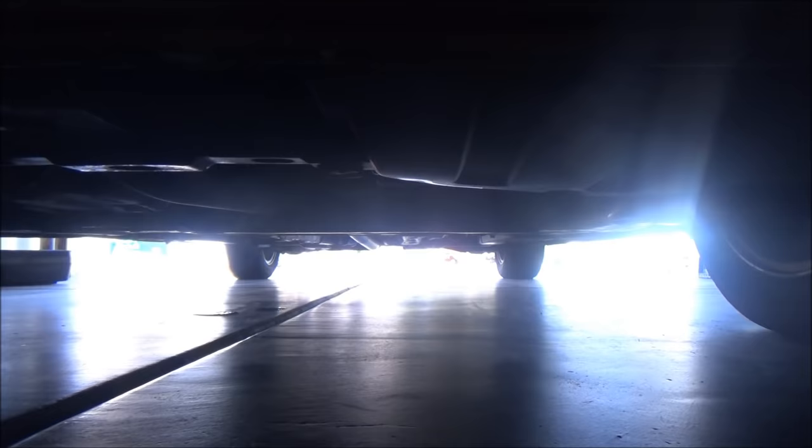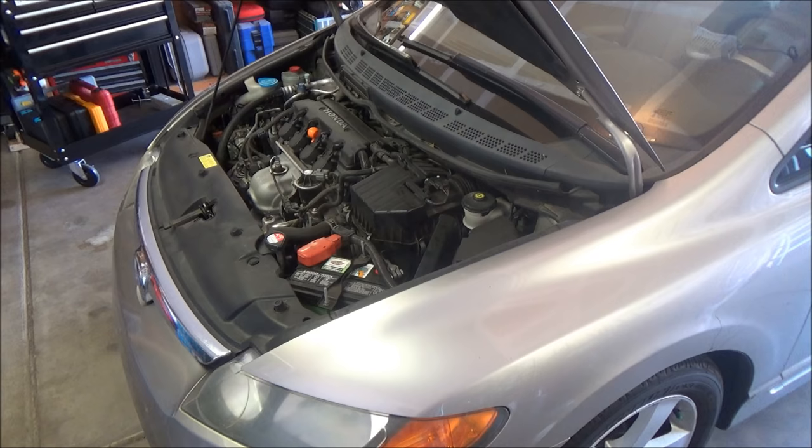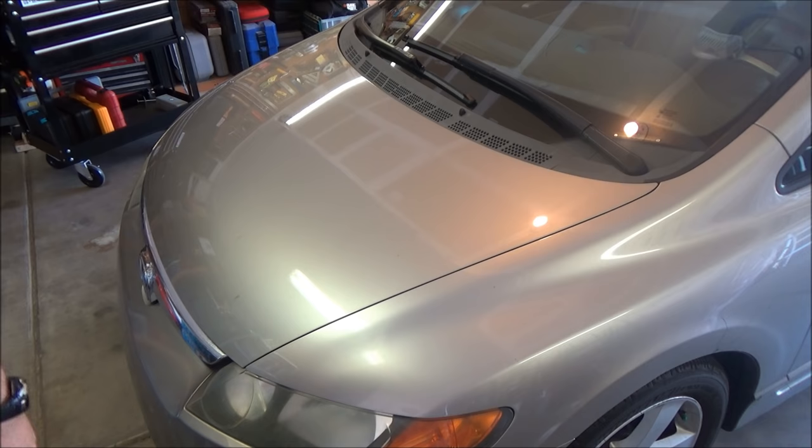Go ahead and go underneath and make sure you don't have any leaks. As you can see, it's not very difficult to change the transmission fluid on a Honda. The book says something like 120,000 miles before you change your transmission fluid — don't do that. Do it about every 30,000 miles and you won't have any issues with your transmission. Don't forget to recycle your used transmission fluid — most auto parts stores will take that for free. Don't dump it down a storm drain or in your backyard. Double-check your work, make sure you didn't leave any tools around. No reason to pay a dealer — you can do this yourself. If this video helped you, make sure to give it a thumbs up. Thanks for watching.